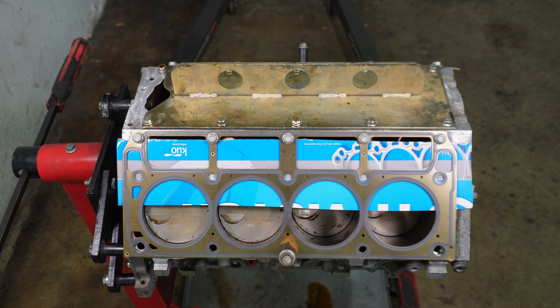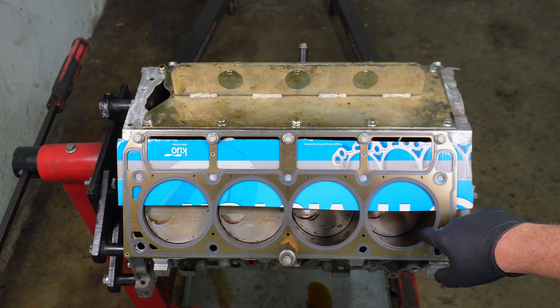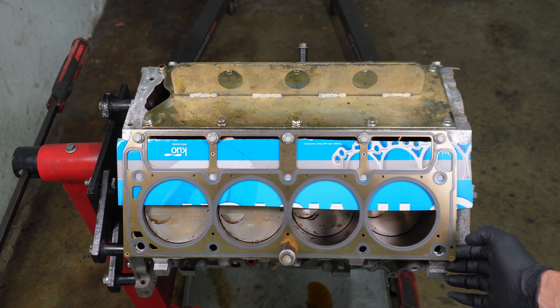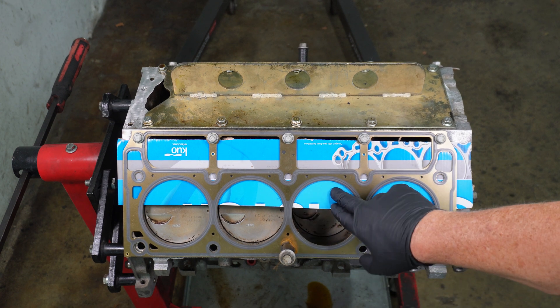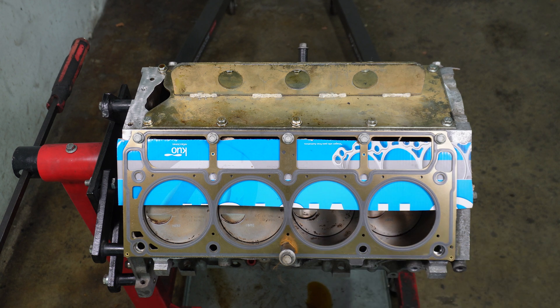To keep the pistons from falling out of the bores — not that they'll just fall out on their own, but in case we push them down or relocate them so we don't have to deal with reseating rings — we bolted down a head gasket. It's a special head gasket with a really thick center layer so we don't have to worry about the sides flexing up. We bolted it down with some cardboard underneath and a long piece of rubber for the head bolt. We could just bolt the cylinder heads down and achieve the same thing, but I hate having extra weight on the engine stand.